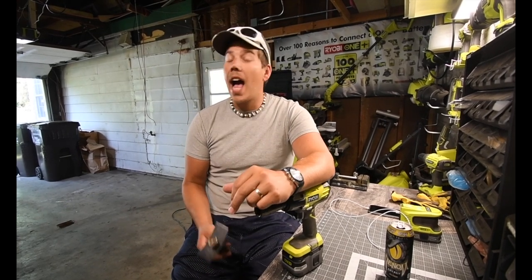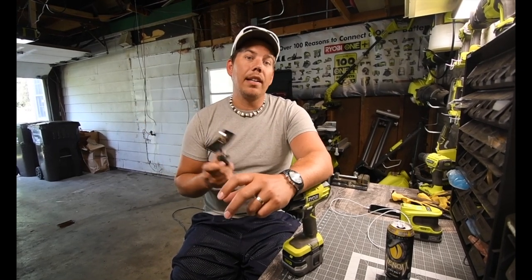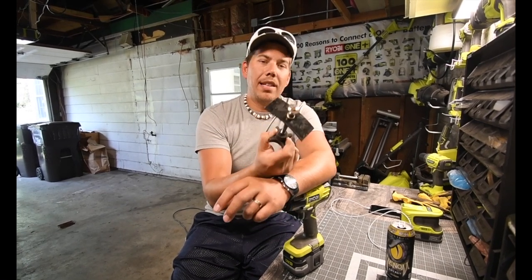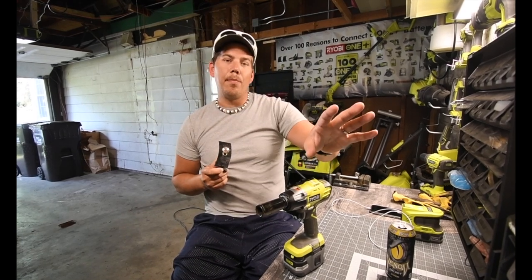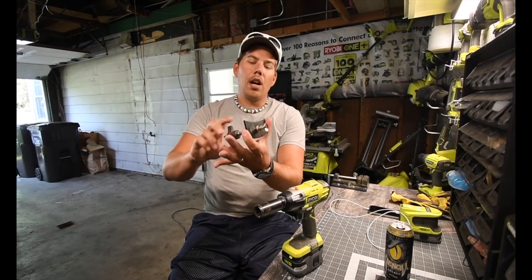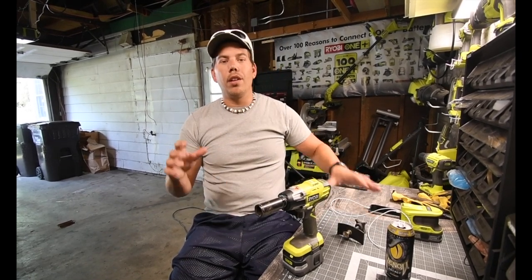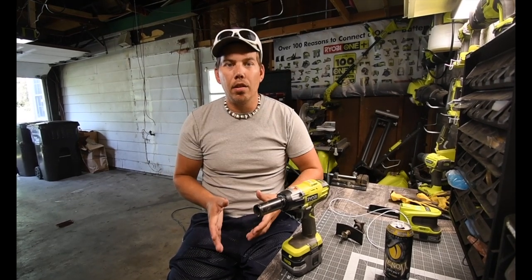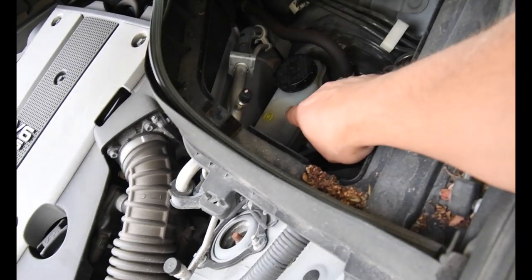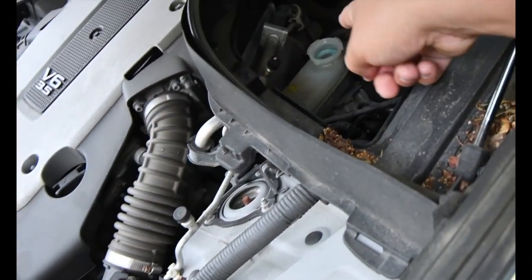If you want to use this video to see how you change your own brake pads, I am gonna do step-by-step showings of what needs to be done. You will need this tool - I do not know what it's called, but what this tool does is push the piston back in that's in the caliper. You put this on it, then you screw it in, and that just pushes the piston back in so the new thicker brake pads will fit onto the rotor. The first thing you need to do is find your brake fluid and take the cap off - make sure you don't lose it, but that cap needs to come off.